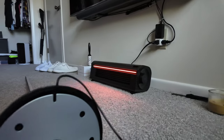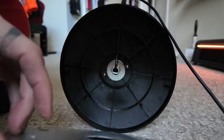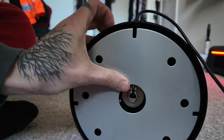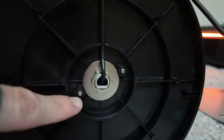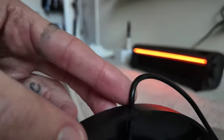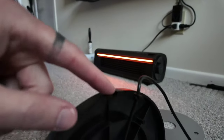Next, you're going to see this silver plate. You just put your finger in there — this is how it sits, resting in there about like that — then pry down and out. The next thing we need to do is remove this screw here, that screw there, and the wire. Very simply, it will just slide right out. Make sure you've got this thing removed from the trim piece.